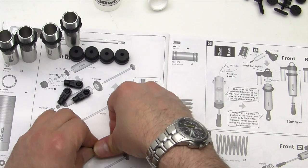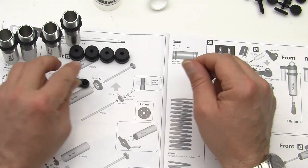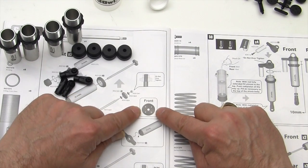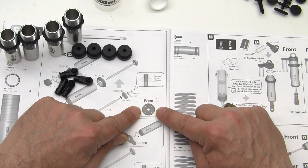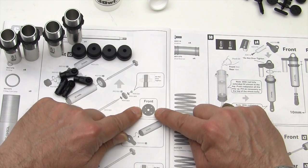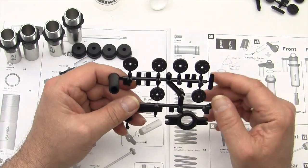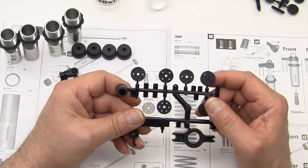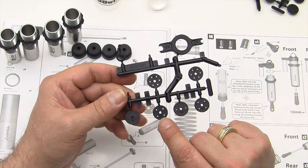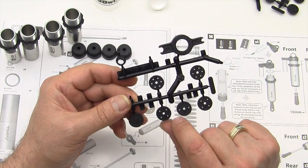Most of the parts are still universal, however there's going to be one difference, which are the pistons. So for the next step, we're going to start with the front, and we're going to get out the pistons, which are the AX31031-10s, and they are a 4-hole piston. If you take a look at your tree here, you're going to see that it's going to be the number 10 unit, which says 1.4, and it has 4 holes in it.